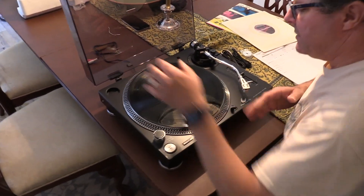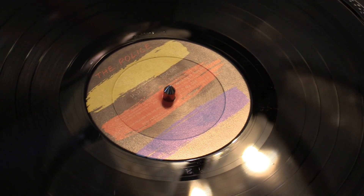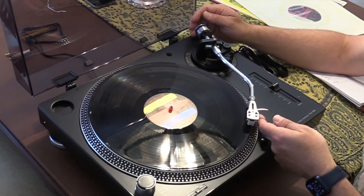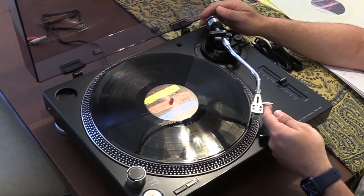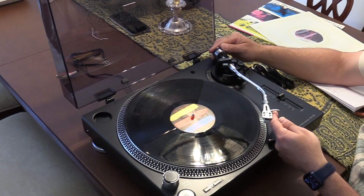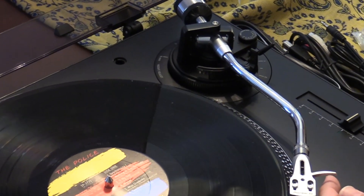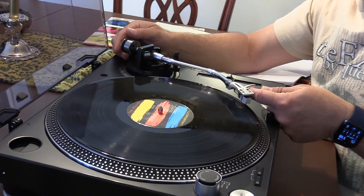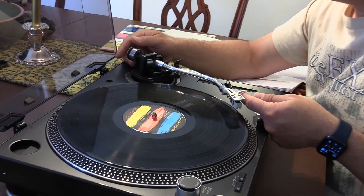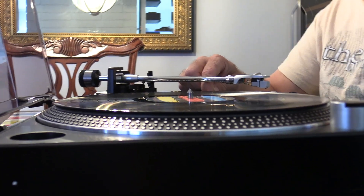One of my favorites from the 80s. Now I can bring the tone arm in and not worry about landing on the felt while I adjust the balance here. The instructions say adjust so it is horizontal. I need a little bit more weight on the back — I'm going to go counterclockwise a couple of hashes here. Some of y'all that have done this before might be cringing at what I'm doing. I've never set up a turntable. I'm going to say that's close enough balanced for me — it's not teetering in either direction.